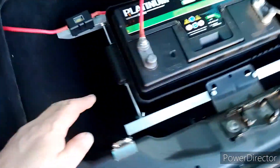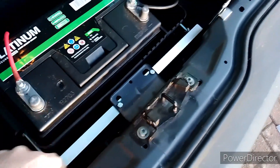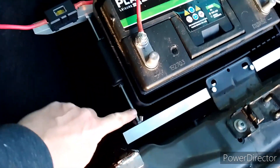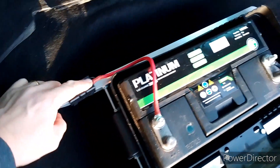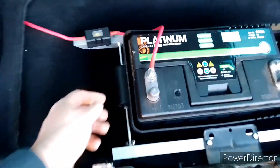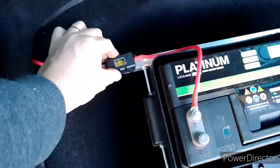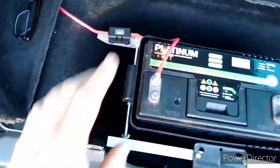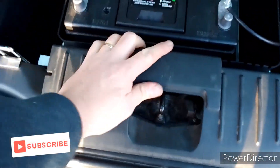This is the completed installation. I've got the battery in the battery box. What I've done is I've got an ally angle bar here bolted into this frame at the back. We've used threaded bar — there's nuts on the back and nuts here to stop it sliding about. I've cut another bar at the front so this is all rigid, the battery box doesn't move at all. I've drilled and mounted the fuse holder to this, so it's worked out quite well — all solid and sorted. When the covers go back on, this cover just fits nicely in here, then the side covers fit on.